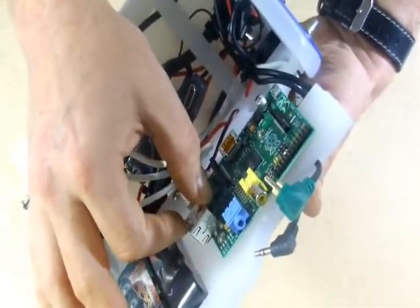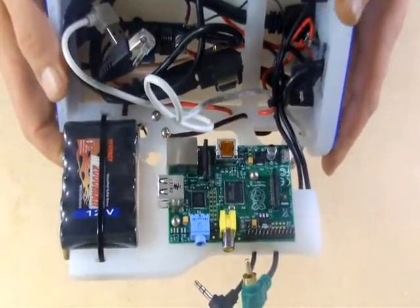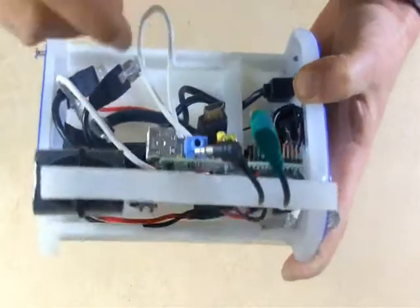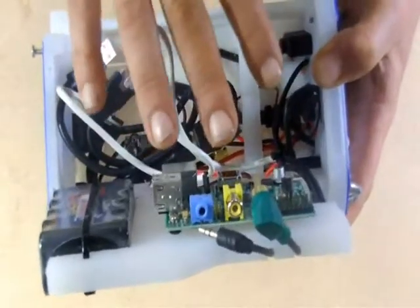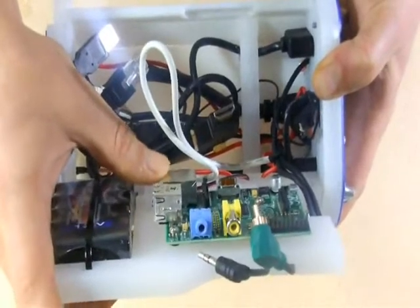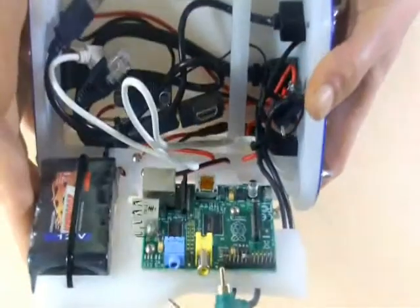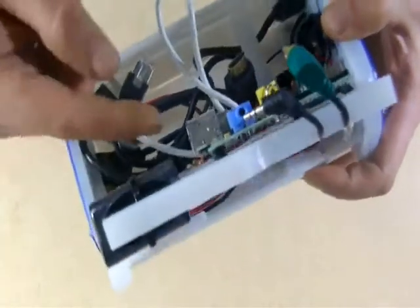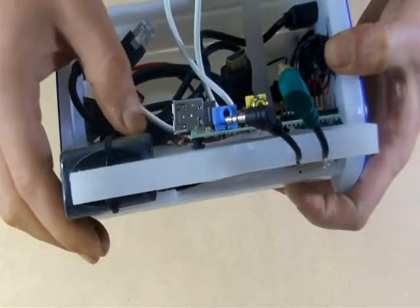You want this movement in the Pi. The main thing that the grommets do, aside from providing some shock absorption, is they prevent the Pi from being attached too far against the chassis and hitting the soldered leads on the back of the board. As soon as you begin attaching wires here, the Pi is going to firm up — this movement is going to stop almost entirely, and all the different wires are kind of cradling and securing that Pi. If you take this screw and shoot it too deeply, then the USB here won't have the clearance it needs to clear the back of the battery right here.